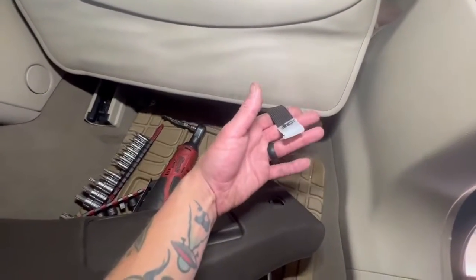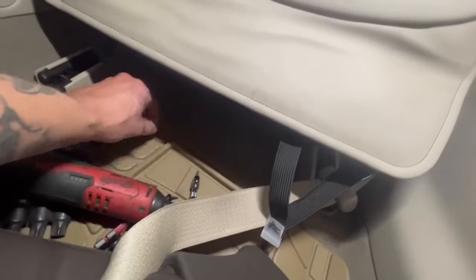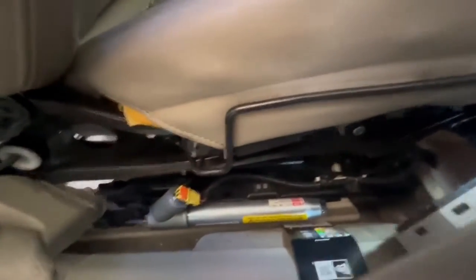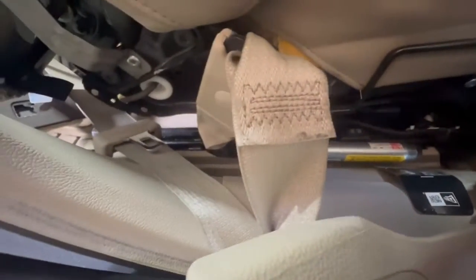To get this flap up it's just these two clips right here that are strapped from the underside. You'll unclip those, lift up the strap, and then you'll see on this side there's a Torx fastener — T25 Torx. That little bar slides into there. So once you get that fastener released, you'll lift up until you get unhooked from there, and then push forward — now you can see I have access to this bottom clamp down here. It'll just be that fastener down there and this little cover that was just covering it up. Next part we'll remove that.